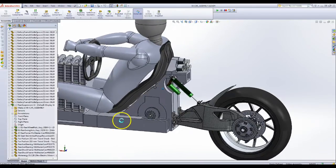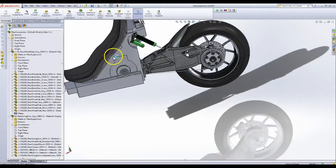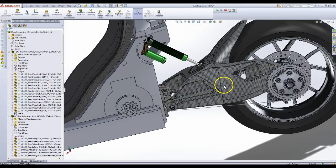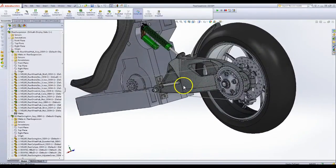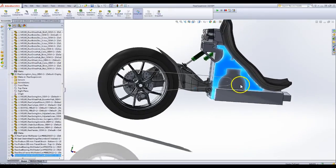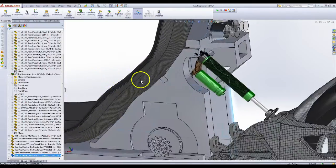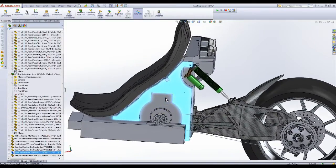So you can see I've got the chain going from the motor to the rear swing arm. The rear swing arm is mounted on bearings that I have bolted to these two pieces of aluminum. It took quite a while to figure out the design of these pieces — they had to fit both the motor, the seats, the bearings, connect to the chassis, and provide a pickup point for the rear suspension damper. But I figured that out. It's got a kind of funky curved surface so that it can hold the seat.